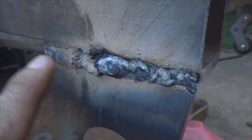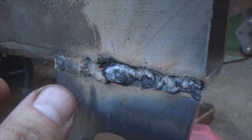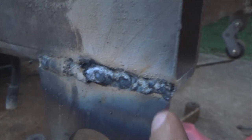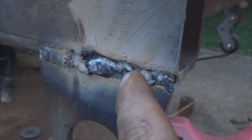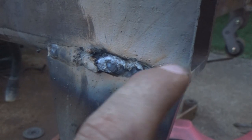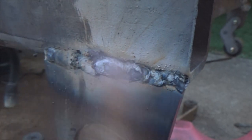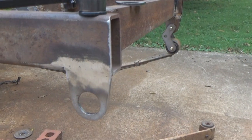So I'm going to take my hammer, tap that thing back out, get it flush again, and then burn my weld in right through there. I made my first pass — you can see where I took a wire brush to clean it up a little bit. When I was going this way I couldn't see my weld pool as well, so I went this way and started pushing my bead. When I was pushing it I would pause for a second, let the wire fill up the gap, come around in a circle, let the wire fill the gap, come back around, and just keep continuing like that.